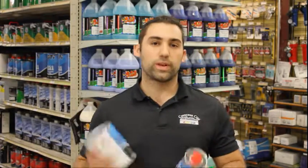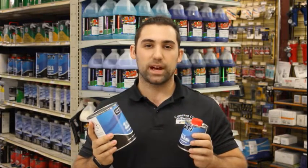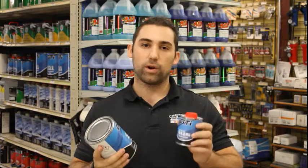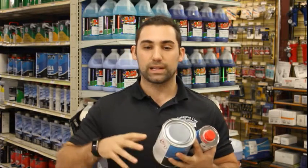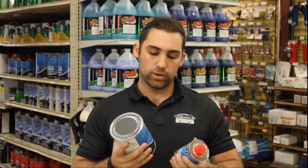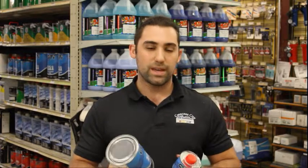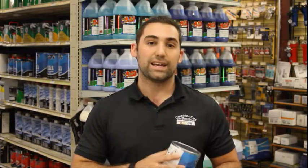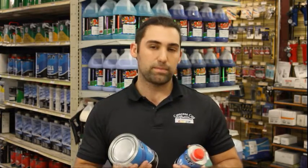Alright, so the urethane primers, these are pretty much the industry standard when it comes to priming nowadays. They usually have a hardener, which is great. That means it's going to dry all the way through and you're going to have very little chemical reaction with other products. The urethane primer dries relatively fast, within an hour to 2 hours. It sands really easy and it has a nice build thickness, which is great for good foundational work when it comes to priming. They pretty much go over everything.